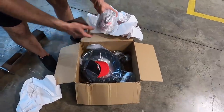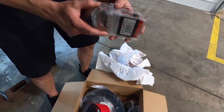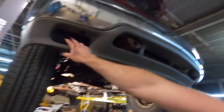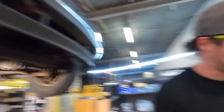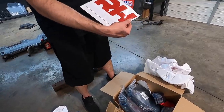Some of this is not for the trans — it's for the fuel system — but we do have the components in here for the trans lines, dash six. We'll be hooking this up to this cooler right here, which is from CSF Radiators — it's actually an oil cooler. I got it for the Escalade because I thought I needed an oil cooler; turns out I didn't, so when the time came to need a transmission cooler for this I said, let's just use this thing.